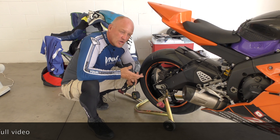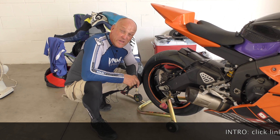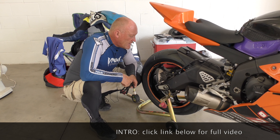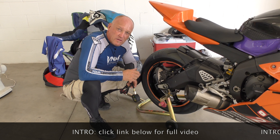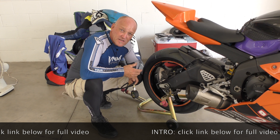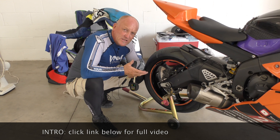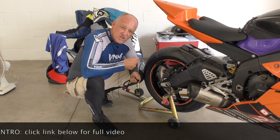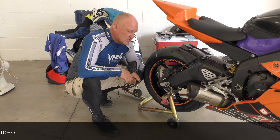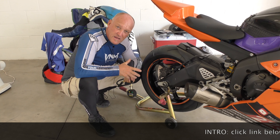The track day tire is a response to the SP, which is a street tire. The track day tire is street legal as well, but it's supposed to be harder wearing and last longer. SPs can last one and a half to two days at the track, maybe 2,500 street miles. So this tire is designed to be more durable. With the track and temperatures we've got, we're going to see what we get in terms of wear and then how the carcass responds to pressure.